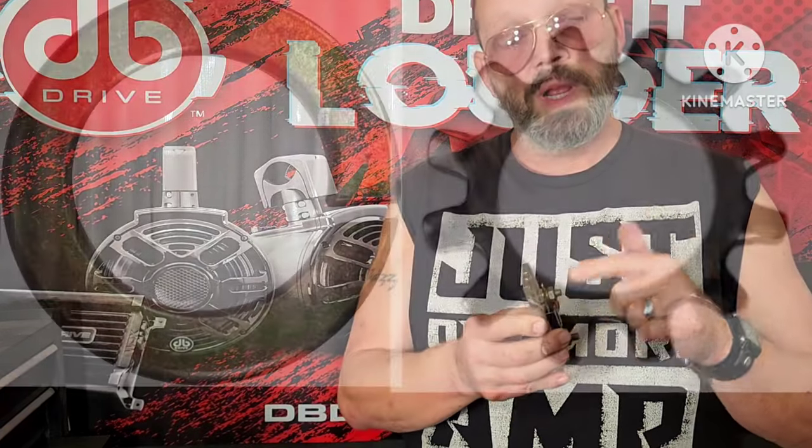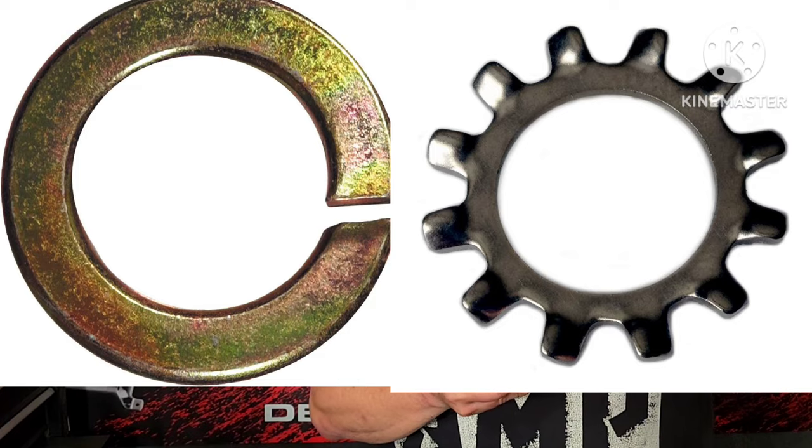Make sure you're getting your bolts tight, your nuts tight, the connection is clean, there's a lock split washer. It's either a split washer or one of the little washers that has little fingers on it that grabs. I forget what they're called. Some kind of locking washer that prevents the nut from easily backing off. If you don't have any of that, put some blue Loctite on it. And get the proper equipment. That's important.